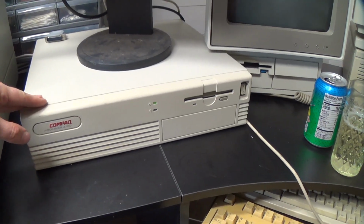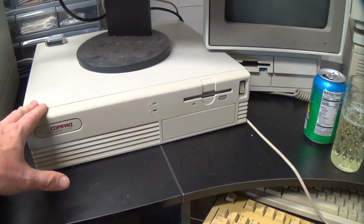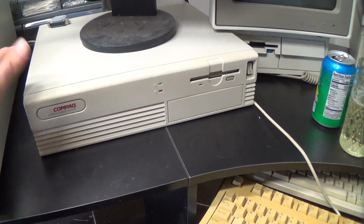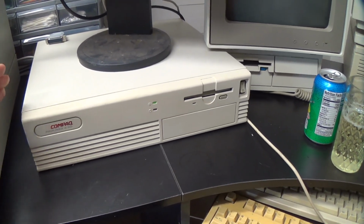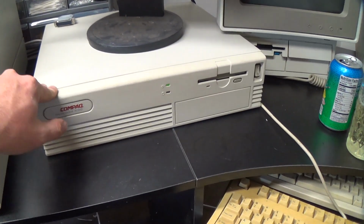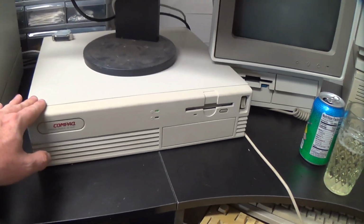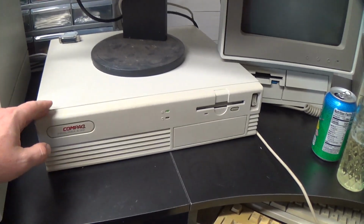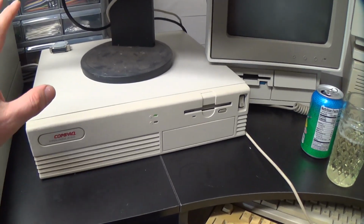If that works and we end up using the machine a good bit, I may eventually try to get one of those Pentium OverDrive CPUs that plug into a 486 socket. A 486 DX4-100 is probably about equivalent to a Pentium 60, and I think those Pentium OverDrives for the 486 run at like 83 megahertz or something funny like that. So I guess that would be a non-trivial upgrade from the equivalent of a Pentium 60, right? Anyway, that's stuff for the future.